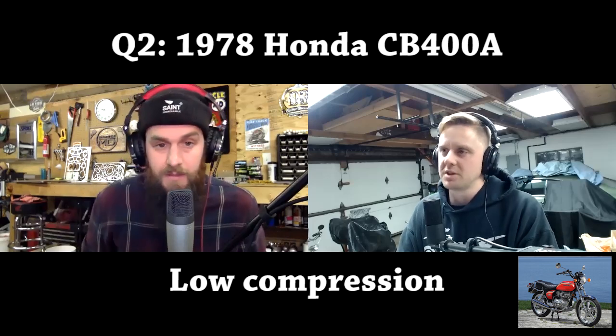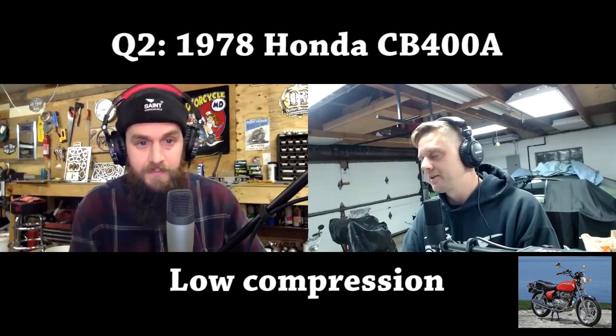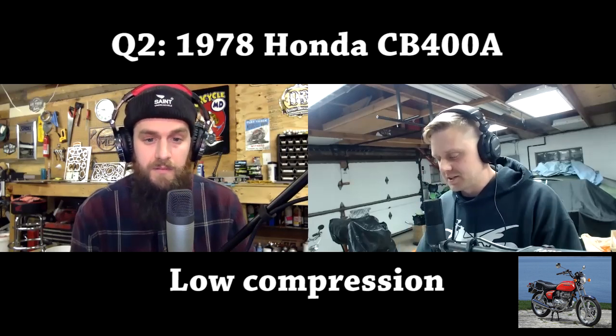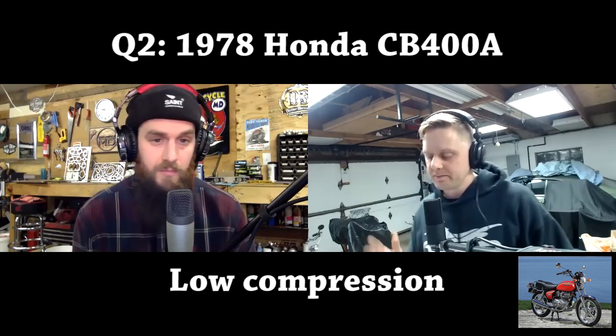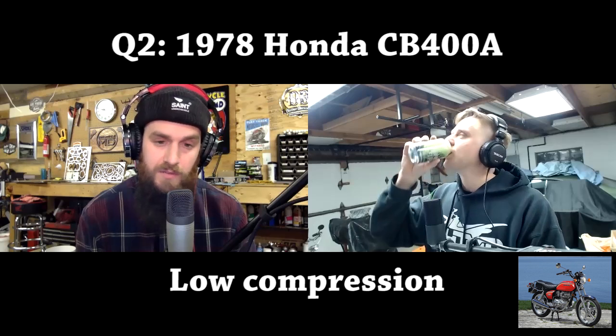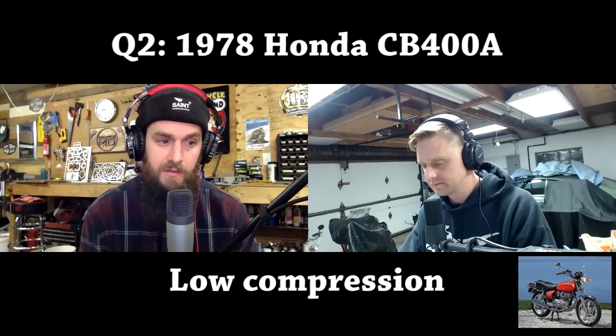Yeah, I just wanted to give this guy a little more info. Oh, yeah, I am using the Harbor Freight gauge. Yes, it has no Schrader valve. Right. Oh, I go by the good gauge. Oh, I got 140 PSI. Now what? Give this guy a little more info. Well, it's carb related. It's definitely going to be carb related. I mean, there's no change with the coils. He swapped over to some Chinese coils. I would put the Honda ones right back on there if there's no change.